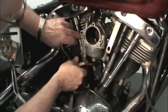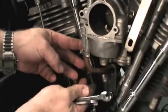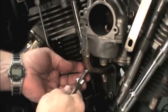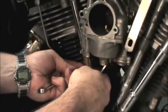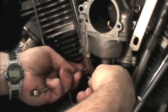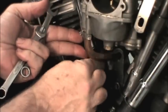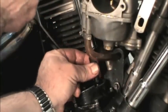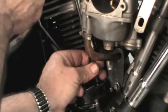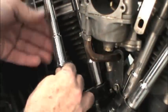Turn the adjusting screw to lengthen the pushrod until it contacts the tappet. Make sure it's seated in both the rocker arm and the tappet. Adjust the length until there is no play or shake, but you can still turn it with your fingers. Tighten the lock nut against the pushrod adjuster and recheck the adjustment of the pushrod. It should spin freely with a little drag.